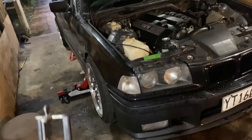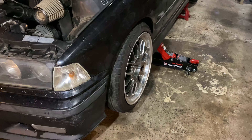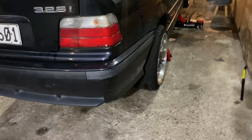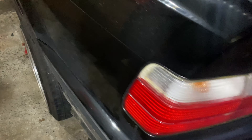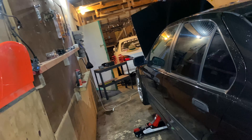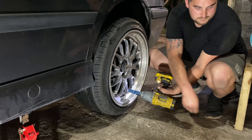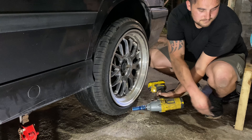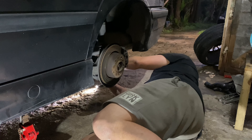Look at that fitment — oh, it looks really good. The other side — very nice. So now we just got to move on to the back. Just got to take the wheels off and then drop one of the bolts at the bottom of the shock, get someone to stand on the hub, push it down, and I'll rip the old spring out and put the new ones in. Should be pretty easy.